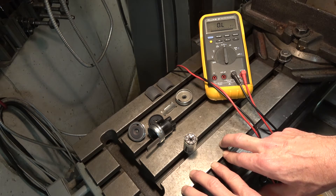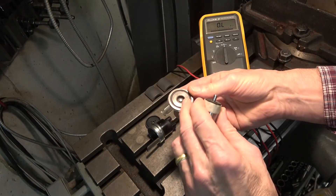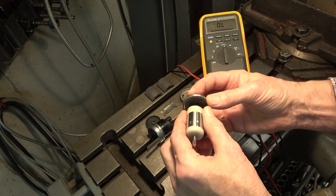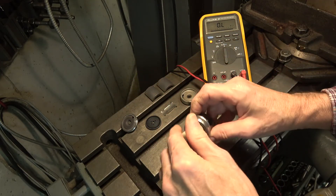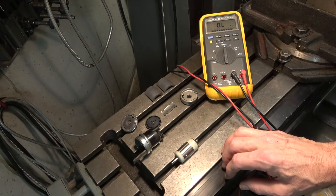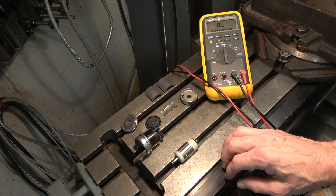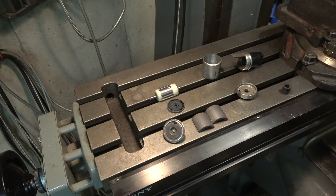That's about all I can do for the analysis. The bearings on the shaft seem good — no wear there. There's a thrust bearing where the shaft presses against it, and that seems good too. So that's what we have — not sure why it failed. But I put the new replacement fuel pump in, installed the whole fixture in the gas tank and the tractor, and everything works fine now. That's my analysis of the fuel pump failure in my John Deere tractor. I've got a few other things to do before it's all ready for winter, but at least I have the gasoline problem solved.